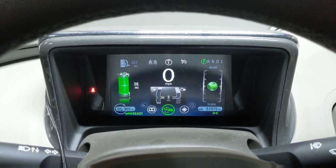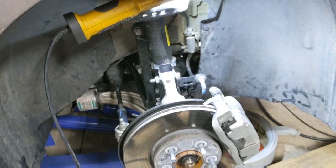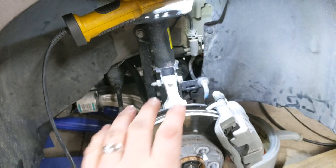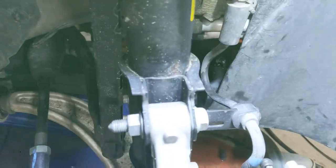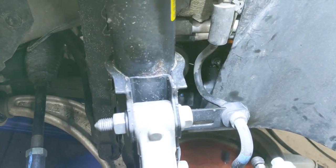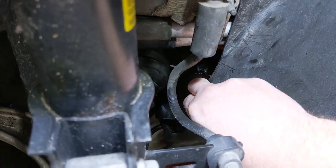Now we need to test the pump and see if it's actually pumping fluid. Now that you've determined the heating element is probably good because you're showing a decent spike in kilowatts, you can reach up here under the right fender well — this is where the pump is located. You can actually see that pump down inside here. That's the bracket that holds the pump on right there. When the pump's on, you should be able to hear it — it's got a little bit of a hum. But if you're in doubt, turn the heat on high, reach in here with your fingers, and lay them right on top of this pump bracket, and you will feel it vibrate.